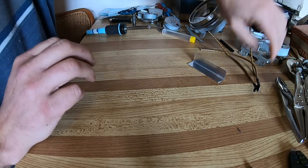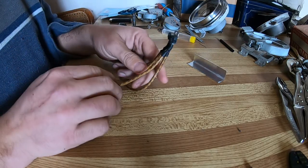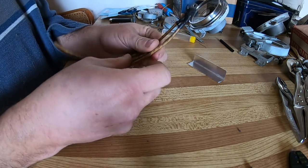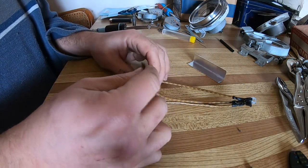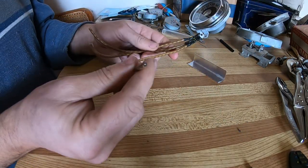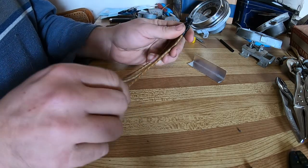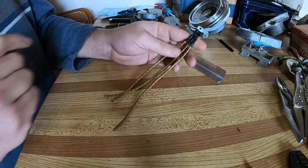That's how you make your own voltage reducer from 12 volt to 6 volt. Basically, the 12 volt comes in here. That's the ground. That'll just go to any ground on here anywhere. And then that wire is going to be 6 volts out. It should be relatively 6 volt. It might be 5.5. I'm not sure. But yeah, I just got to put the appropriate connectors on there, and once I get everything cleaned up, that'll all go back together.